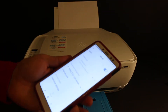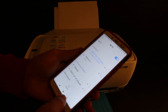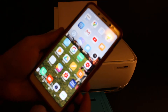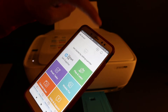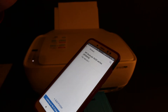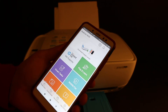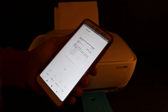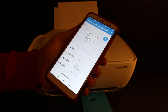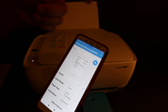Here you can see the name of the printer and the Wi-Fi password. Now take your iPhone or Android phone, open the Wi-Fi settings, and look for the printer's name — HP 3630. Enter the password and once connected, go back. Now open the HP Smart app. In the HP Smart app we have to add the printer, so click on the plus button on the top. The printer will appear on the next screen — click on it and shortly you will see the printer is added and it displays all the information. Go to the print document section and select a PDF, then click the print button. You can see the name of the printer — 3630 series — and the blue icon on the top; click on that.